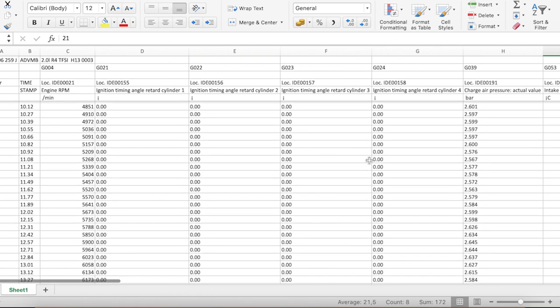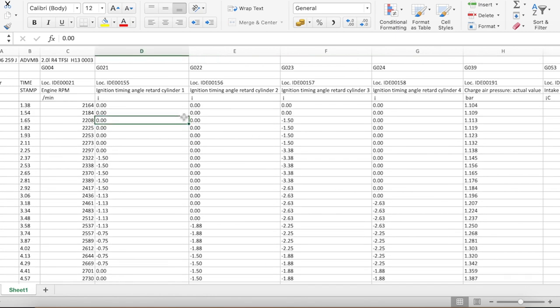We're really happy with the results. The setup is a forged engine with forged pistons and rods at the same compression ratio, running our IS38 450 turbo, a front-mount intercooler with charge pipes, water-meth injection, and a downpipe. No full exhaust system, no intake upgrade — stock airbox and stock intake — with only a 90-degree bend upgrade at the compressor inlet. With that completely stock intake and exhaust, we're doing 479, call it 480 wheel horsepower.